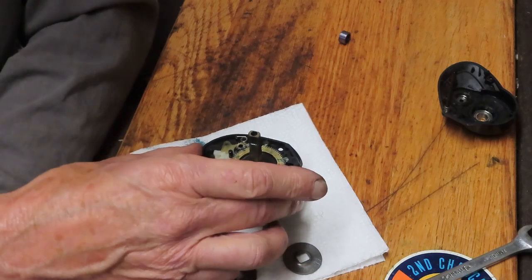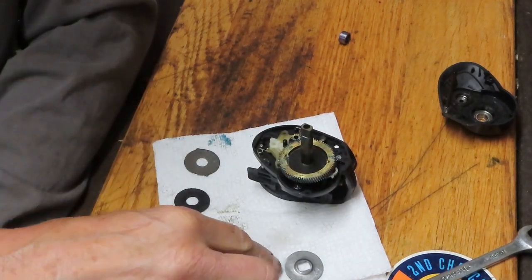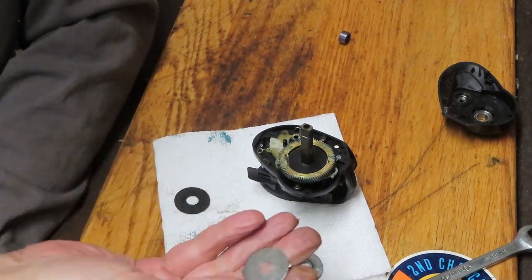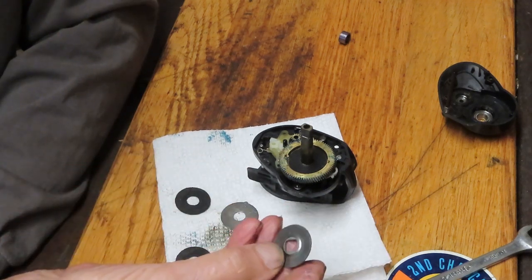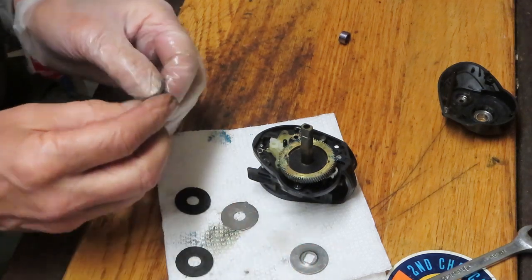All right, first washer is in. There's 3 fabric washers. There's 3 metal washers. We have a flat washer with a rectangle. We have a round washer, round inner circle with 2 prongs. That's called an eared washer. We have the flat washer with the bell housing. So make sure that you differentiate them as you go to put them in.